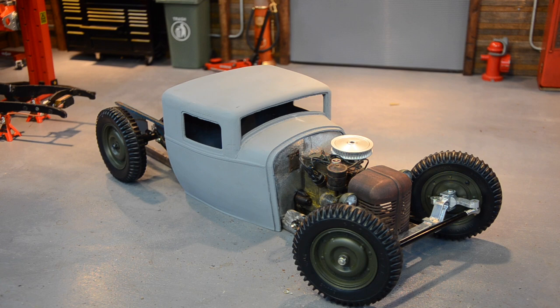I tried to play a little bit with patterns as far as sanding that. It didn't really work out, but we'll let it rust. I'm not going to do it right now because we're so early on in the build. But we got it all clearanced out to fit around the bell housing for the transmission, and the starter, and the couple mounting points and stuff on the other side.